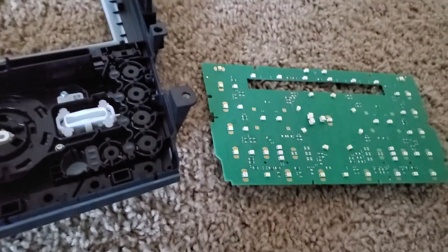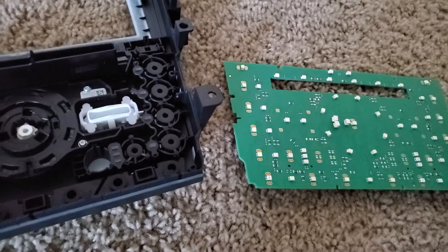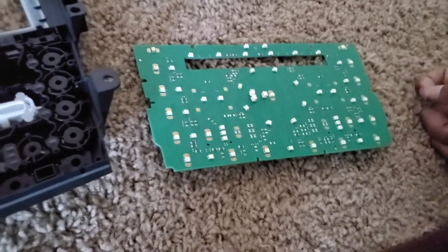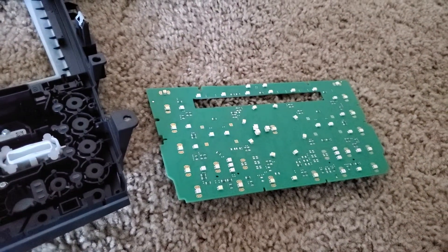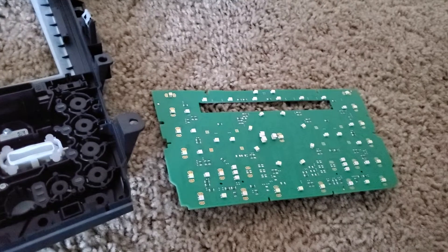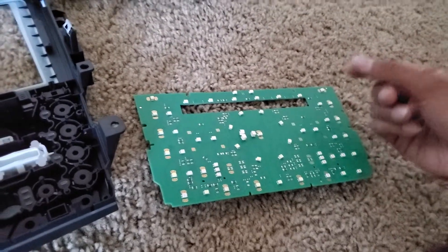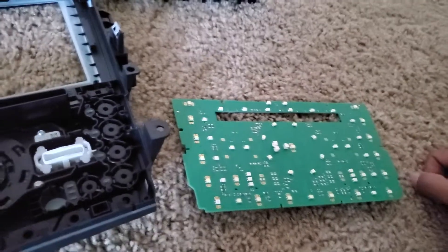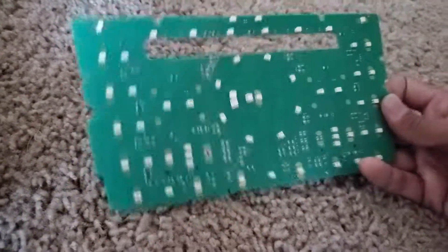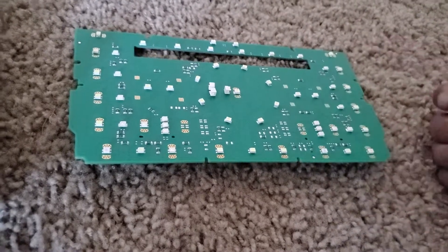If you're actually adding cooled seats, you'll also need to add the hardware inside the seat itself. You'd probably be buying a whole new seat, because cooled and heated seats don't use an electric coil heating system — they use a fan module, possibly with an electric coil inside, that goes under the seat as a whole unit. The car I have right now only has the electric coil heating system, so to change to cooled seats it's literally just a direct swap of the seats, and then you can modify or swap the control panel.